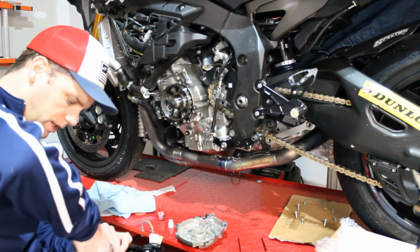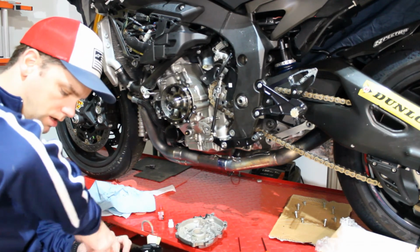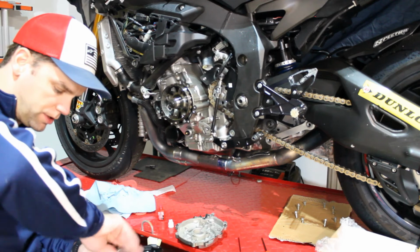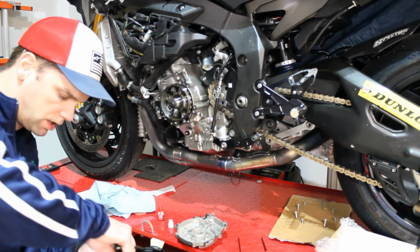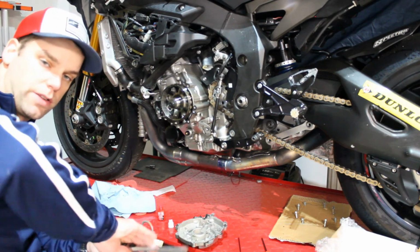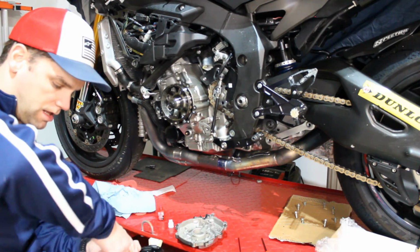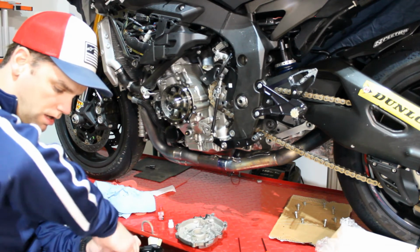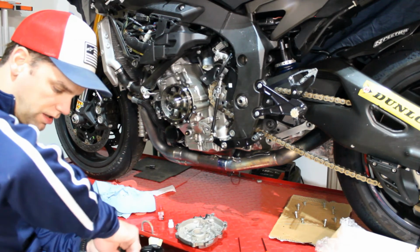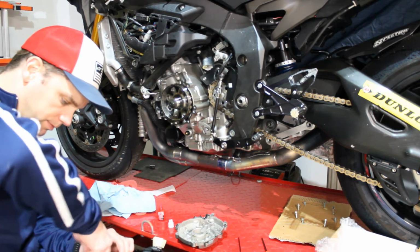It's important with pretty much anything that you're tightening down that you don't tighten down one bolt all the way at first, because what that's going to do is it's going to put uneven pressure on the piece that you're tightening. So if you tighten one bolt down all the way, you can kind of picture that's going to tip up the other side of whatever the piece is you're tightening down. It's going to put it at a bit of an angle, and then when you go to tighten the other pieces down, everything's going to be a little bit misaligned, and you risk just scraping a little bit on the piece and just having not a nice, even, flat surface. So you kind of just want to get to the point where it's just barely touching.